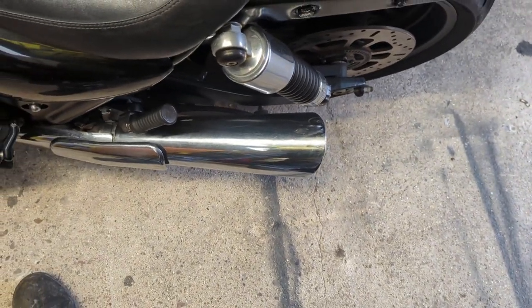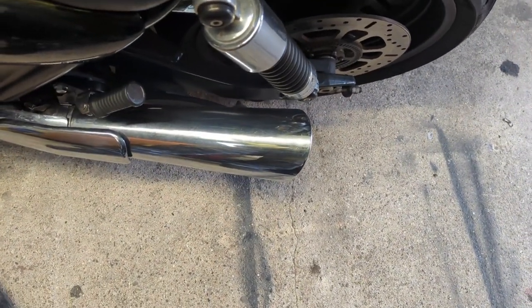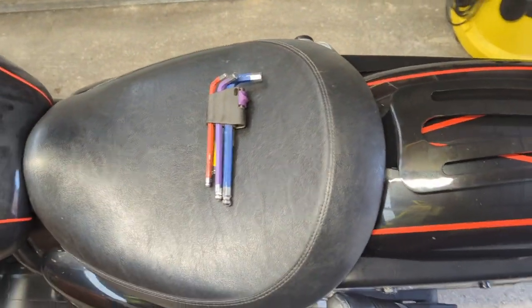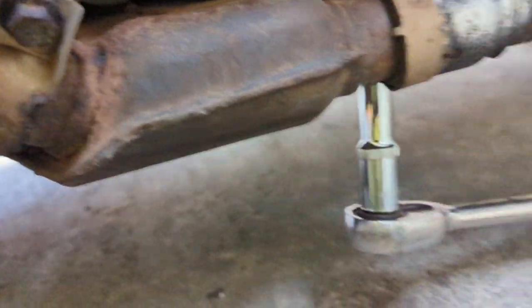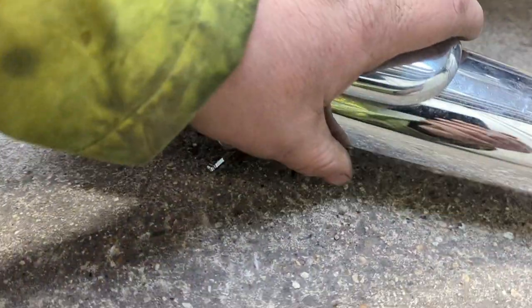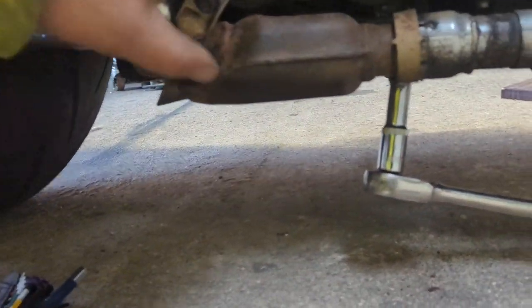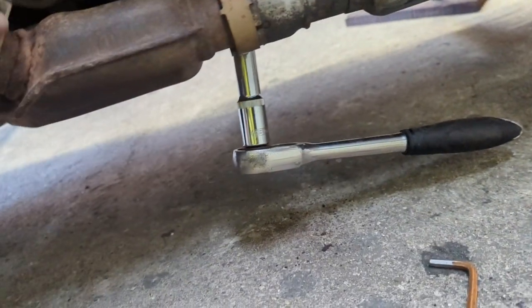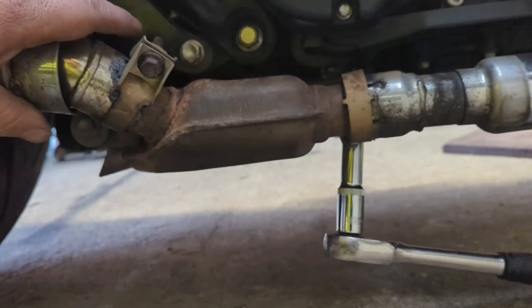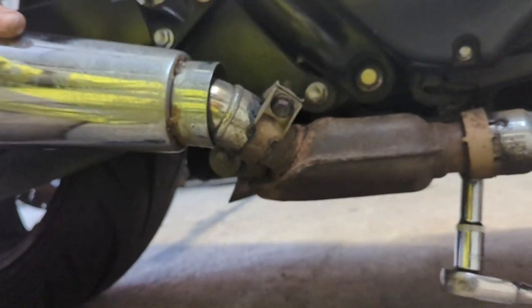It's got short toes on - positive deal. So far it looks like allen keys. Let's start stripping. That's one cover off - allen keys, one, two there - then these clips off the back, just unhook and give it a good tug, leave them off. Then you've got 13 mil - 12 mil sorry - bolts here and here, then I'll loosen these clamps off and get this back exhaust off.